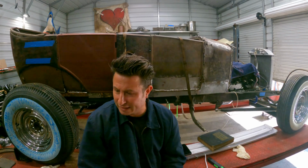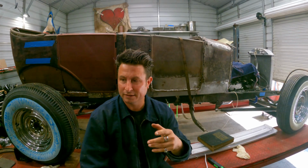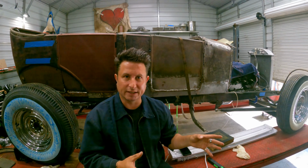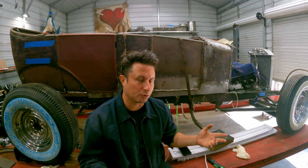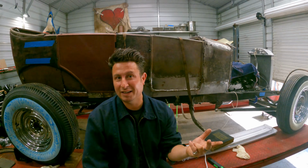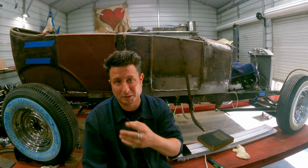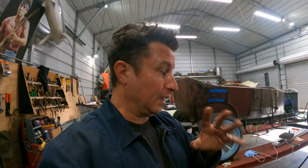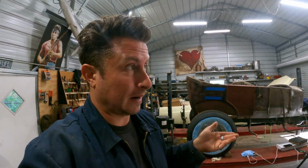So I thought, why don't I just get a stock cam? Something that would have been in a V8 motor with 461 heads. It should keep stock rocker arm geometry pretty similar. I mean, the push rod length might be a bit of an issue depending on the head gasket and all that, so I understand that. But a stock cam is gonna do everything I need for this motor, and will increase the compression a little bit with those heads and maybe just get a little more oomph out of it. Right? That's the working plan at the moment: to find a new old stock camshaft, GM, stock, everything, with a set of lifters maybe, and hope for the best, thinking that maybe that's a recipe for better success. I'm assuming those have gotten more expensive than I want to pay, based on current YouTube trends of bad camshafts.